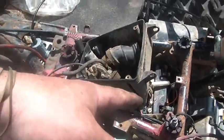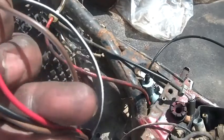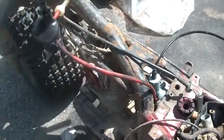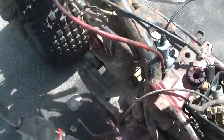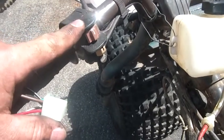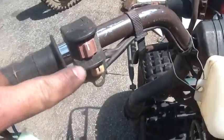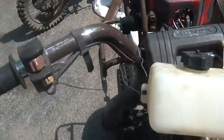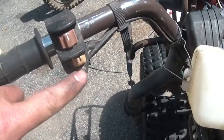The red wire goes to the battery - you should have a fuse on it first, but the red wire goes to the battery, to the fuse box, to plus 12 volts. When you turn the key switch to the on position, 12 volts comes out on the black wire and goes to your handlebar switch. At your handlebar switch it feeds the switch that powers your lights and the switch that powers your starter.